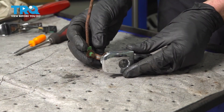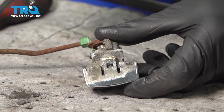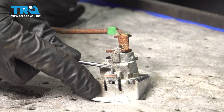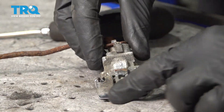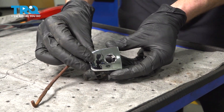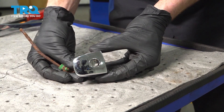Now let's make our way over to the bench. We'll be removing the lock from this trim piece. You're going to find one locking tab that holds this in place — we'll pry this away from the locking cylinder and pull it out of place. Use a pick to make your way in between this area, being careful not to hurt yourself. With that separated, continue on prying this out — sometimes you can just twist it out, other times you may need a small prying device like a pocket screwdriver or flathead screwdriver. Now that we have the old one off, we'll compare it to the brand new one and set that aside. We'll take our new piece, put it down on something soft so we don't damage it, roll it right into position, press it down, listen for a click, give it a tug to make sure it's secure, and get back over to the vehicle.